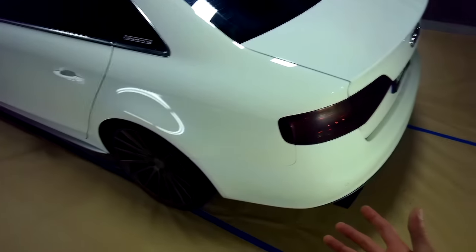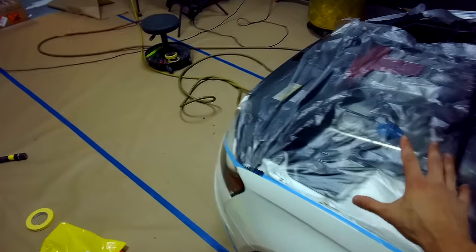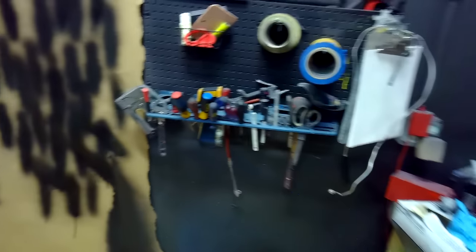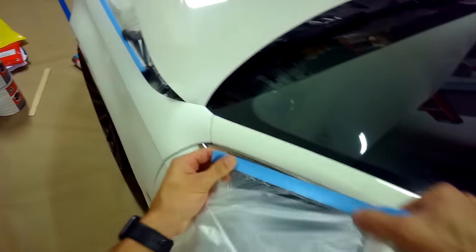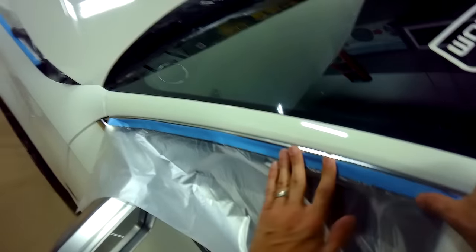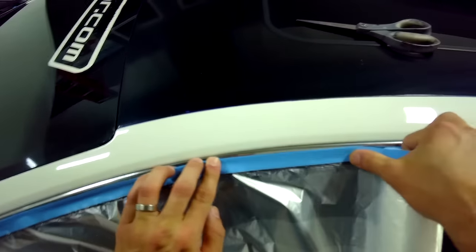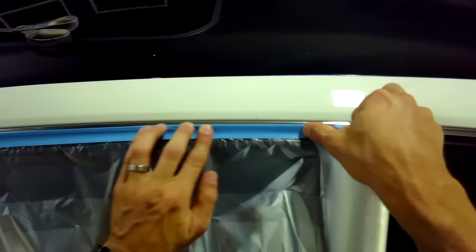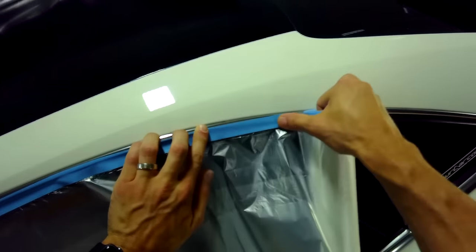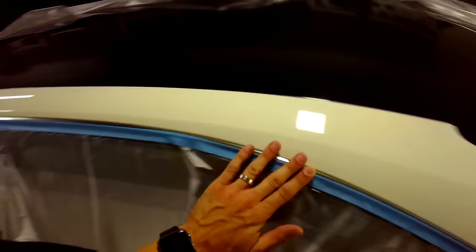If you half-ass the masking, you're going to need to put more time and energy into the cleanup. I'm going to grab some tape and drape and start working on the windows. What we usually like to do is start the tape and drape along the top area of the window trim, leaving a little space because I'll come back with the blue tape and yellow tape to edge everything off. We just work the tape and drape around the area. Obviously every car is going to have different window trim, front bumpers, rear bumpers, diffusers, but the principles for masking are usually pretty similar.